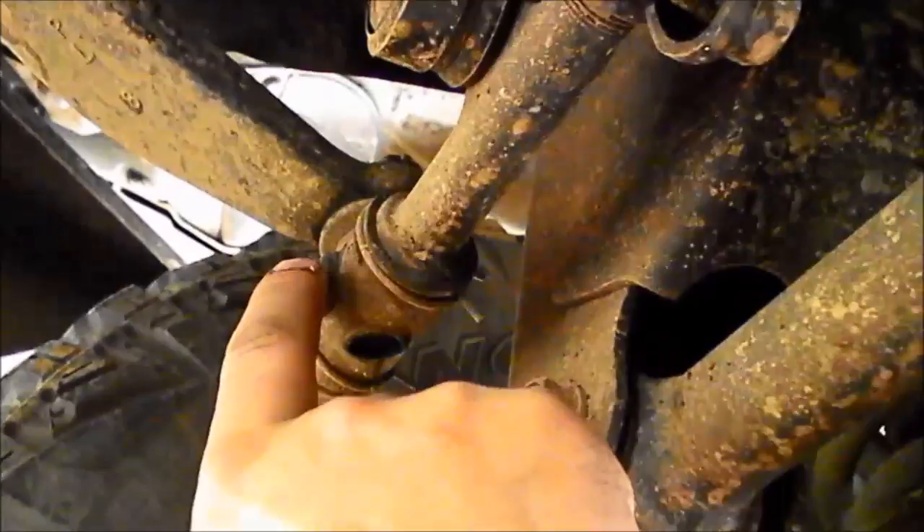I've just noticed that the universal joints do have grease nipples — you can see where my finger is, it's pretty dark. There's one on the rear tail shaft and you've got your front tail shaft which has universal joints as well. We'll have a look on the steering linkages and just make sure — sometimes these ball joints have a little grease nipple. If they do, we will grease them. If they don't, they're a sealed unit and don't need greasing.